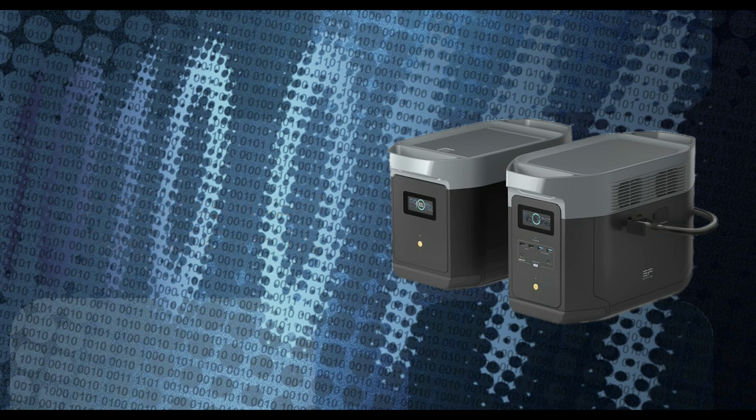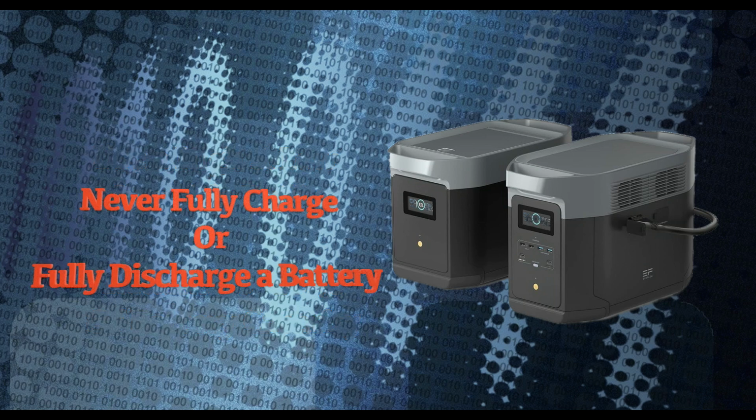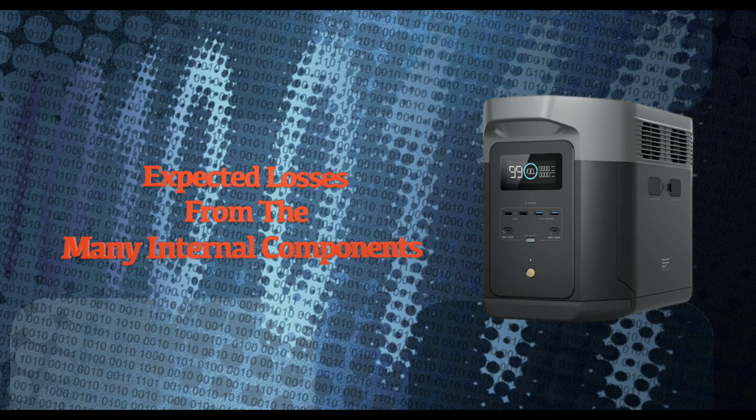Regarding capacity, all lithium batteries utilize a high and low non-usable buffer, which retains about 10 to 20%. So regardless of percentage shown, you can never fully charge or fully discharge your battery. Like any RV lithium system, there are expected losses from the inverter, down converters, solar controller, main processor, LED display, and even the cooling fans.